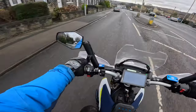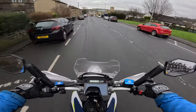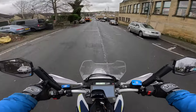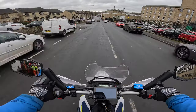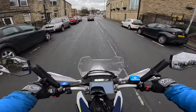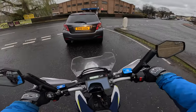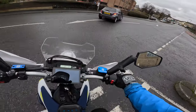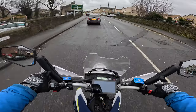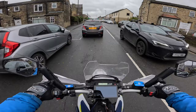So that when it's warm and I drain it, it will flow out nicely and hopefully remove any particles that might otherwise have stayed resting within the casing. The only other thing I do pre-dropping the oil is take the bash plate off — in my case it's an AXP aftermarket bash plate. The reason I take that off is simply to avoid burning myself on the exhaust, and I say that through experience because I have done that before and it's bloody painful.